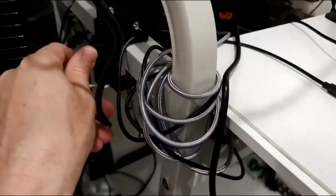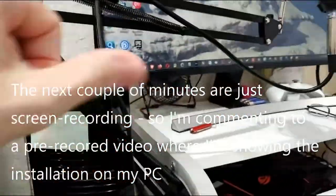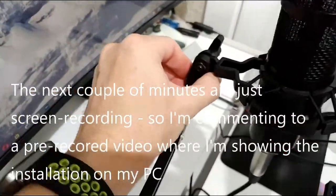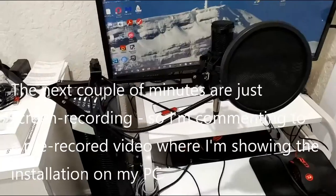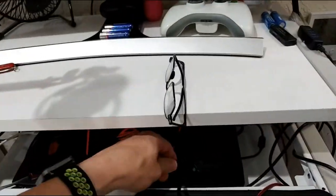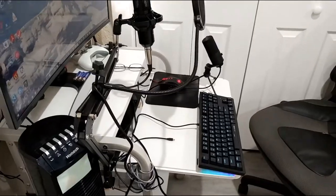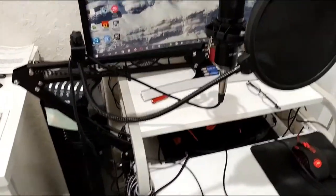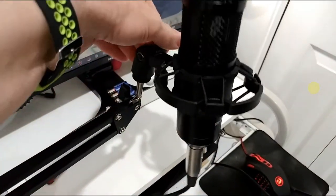I'm now recording from the microphone and I'm super close because the sensitivity is not minus 32 — it's maybe minus 42, minus 52, or lower. It's extremely low; you have to almost eat the microphone to be heard, and I still need to boost the sound level. The quality is super bad. Using the 3.5mm to USB adapter, there's really strange noise — I saw complaints about this in reviews and couldn't believe they'd include such a cheap adapter.